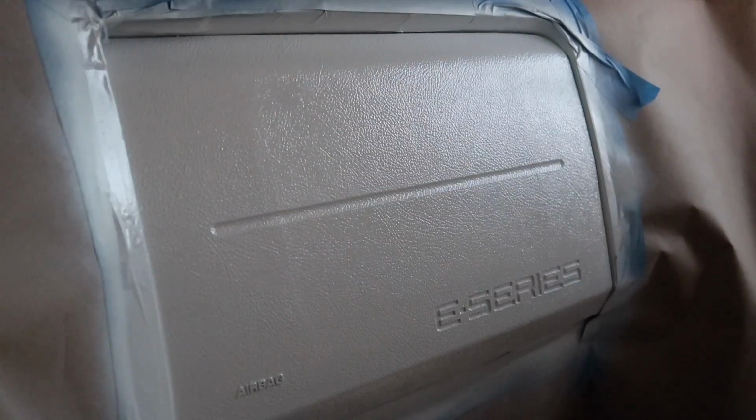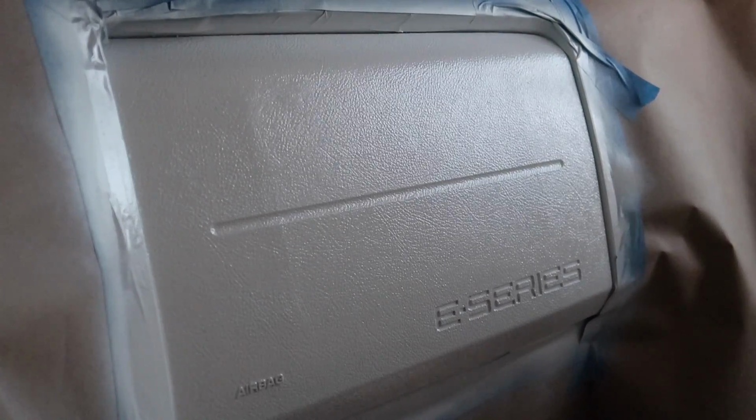And then we'll go ahead and put a finish coat on, a light coat, and I probably want to do 3 to 4 light coats, and then give it one final coat of finish, letting it dry in between coats. And that should do it for this project. So let's give it another 15 minutes and we'll be back.